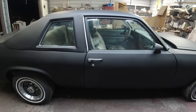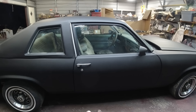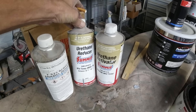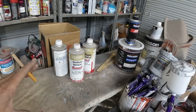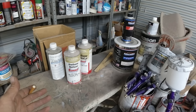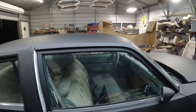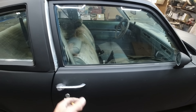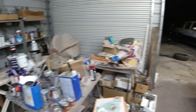The reason why it turned out so clean is because it was about 80 degrees out at night — around 9 or 10 o'clock — and the paint dried really fast, mainly because of the reducer. This says mid-temperature. You can get slow, medium, and fast reducer. Whenever you paint a car, if it's really hot out, use slow reducer. I probably should have used slow there. But when you paint flat black, it doesn't matter. When you're painting gloss, you want to go around the whole car and still have it be wet when you come back to an area, so it doesn't leave a dry spot. With flat black it doesn't matter, so it's probably best to use the medium or fast reducer.